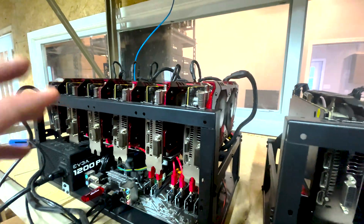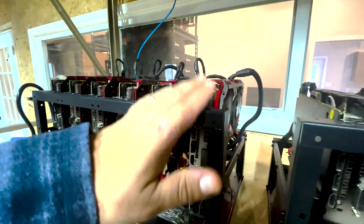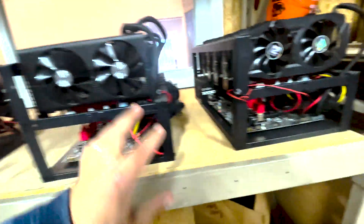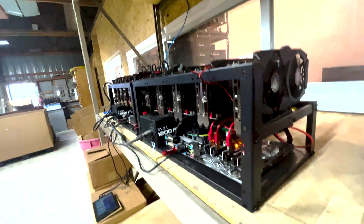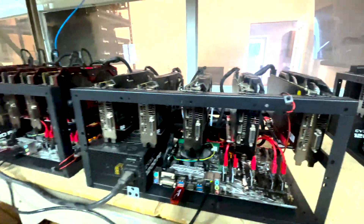Running only 30% fan speed allows us to make sure the fans don't burn out over time. These are cards from 2016 to early 2018, running essentially three to five years continuously without fan problems — because they're running at 30%. If you're running cards at 100% fan speed, you're going to get about two years max out of them. A lot of the Nitros, the ASUS, and other Power Color retail cards end up having that problem. You can see here we have one with a little wobble — some fans also have stickers, so be careful.